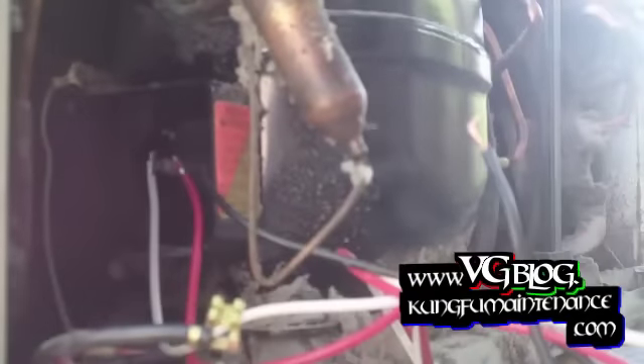Obviously we don't want anything touching here — any of these wires touching. So I'm just going to bend them the other way. Then these you strip off and connect one to each lead on your three-in-one start. I'm going to grab some wire strippers — you always want to use wire strippers.